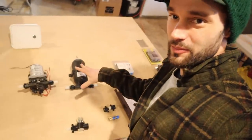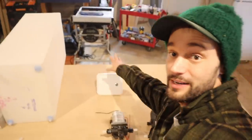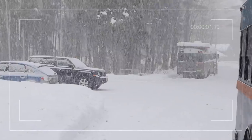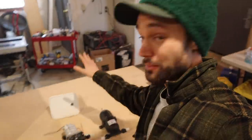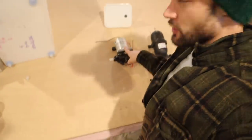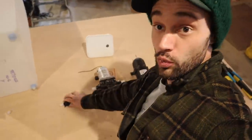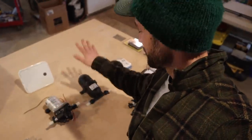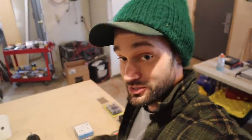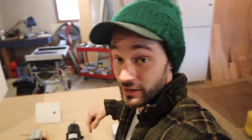I got all the parts laid out. We're going to be installing right here. We're not actually going to be able to put the water inlet to the exterior of the bus because it's snowing — it's like 10 degrees and we can't cut a hole in the bus. But the water would be going from here into the tank. We're going to install the tank, and then we got lines going from here to our filter, then from the filter to the water pump, accumulator, eventually into the heater system, water heater, off to the shower, off to the sink. I just laid it all out so I can get the parts list for Rachel.